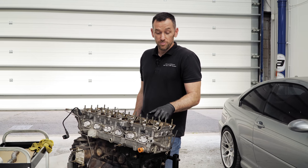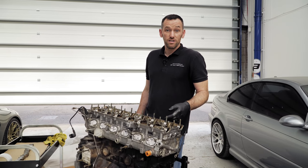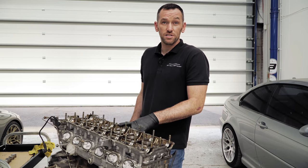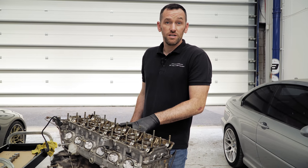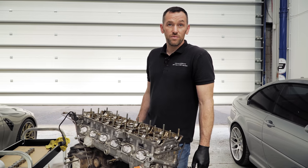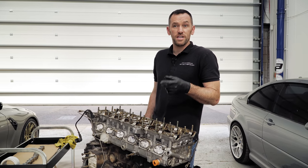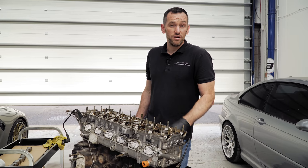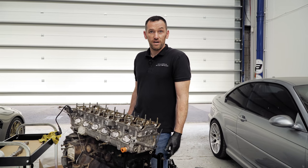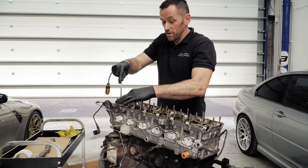They went through a spell of trying a Teflon coated one made of aluminium, which really didn't work. That's why we see S54s mainly between 2004 and 2006, and Z4s, spin shells. The oil pump pressure valve sticks on them, and it's just not getting enough oil pressure. It sticks, so when you turn the key, there's not enough oil pressure. It just slowly but surely takes a bit of copper off, eventually the bearing spins. But the latest oil pump is fine. They've basically refined it to the point where they haven't changed it for 5 or 6 years now. So, well worthwhile doing that.